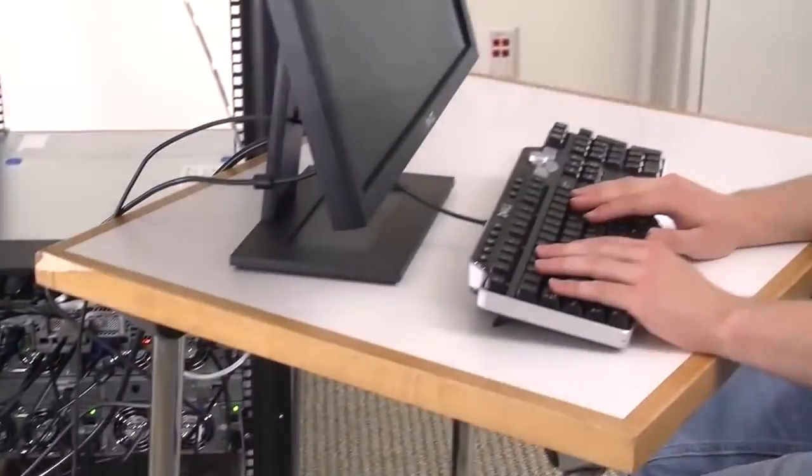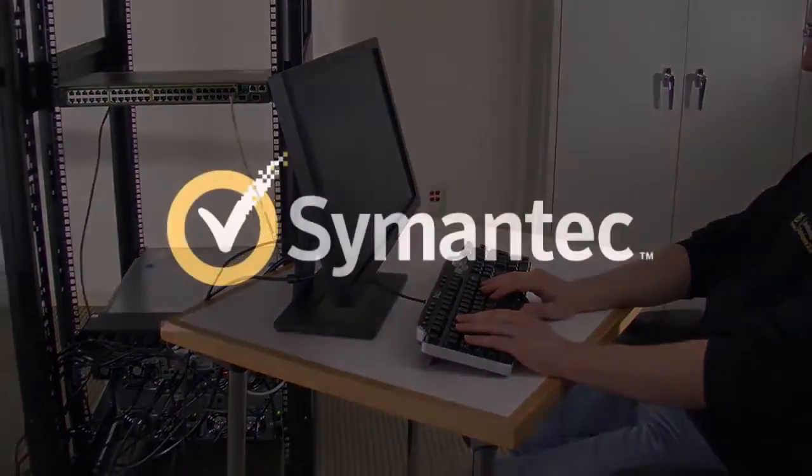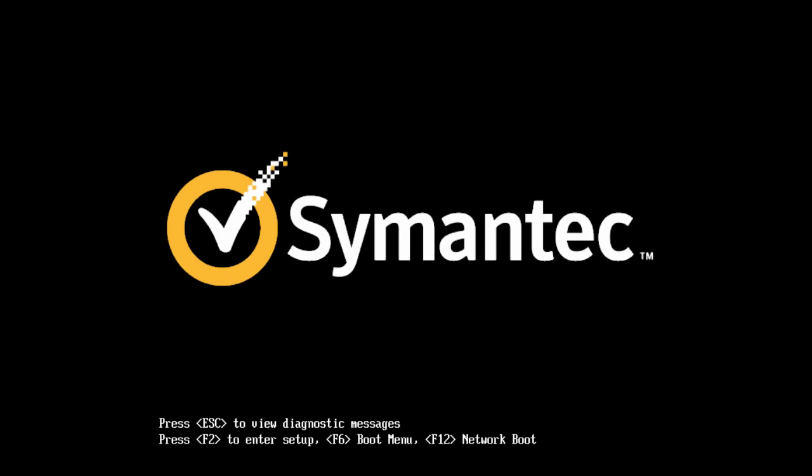When powering on the 5230 appliance, make sure someone is at the attached keyboard and monitor. As the appliance boots, it will issue 3 beeps to signal that the BIOS prompt will be displayed soon. Do not enter any commands until you see the BIOS prompt. When the BIOS prompt appears, immediately press F2 on your keyboard to enter the BIOS setup screen.